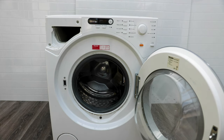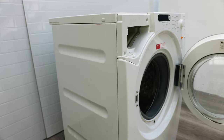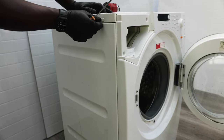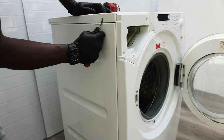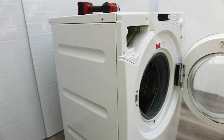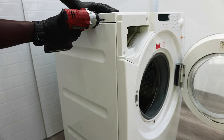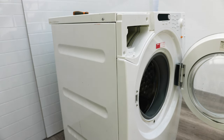The next stage is we want to remove the top cover off the washer. The top cover is held in place by two screws, one on the left and one on the right. With your flat screwdriver, pry out the little protective cover, then undo that screw. You don't need to take it all the way out — just press it inside and it comes out. Do the same for the other side.